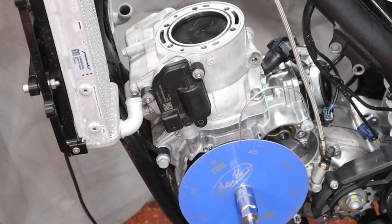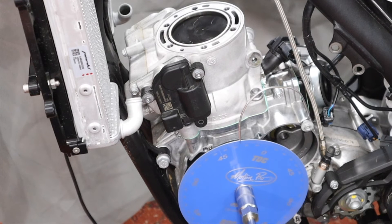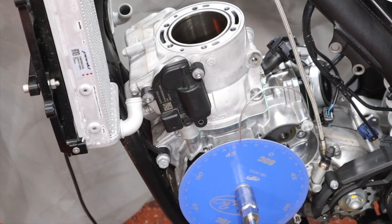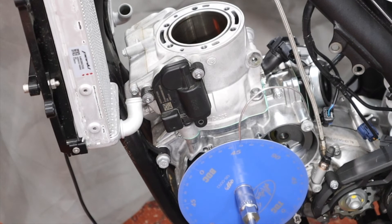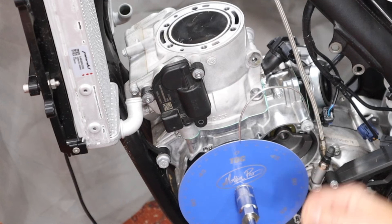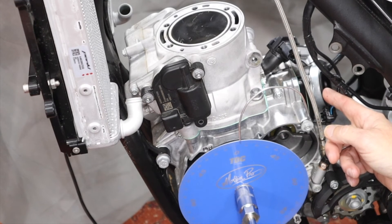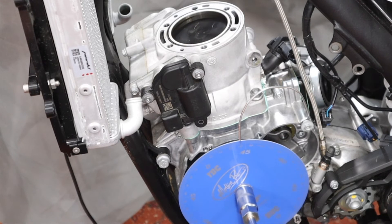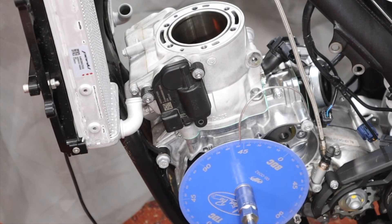For it to completely burn, at a higher RPM your timing numbers would be higher — maybe 30 degrees before top dead center at 10,000 RPMs, instead of just idling around where maybe it's only six degrees before top dead center. The other aspect of this is the filling of the cylinder. There's a suction cycle and a compression cycle on a motorcycle, and all the air has to get into the cylinder somehow to mix with the fuel, compress, and burn. We'll have our time to ignition, our air-fuel ratio, and our compression to heat things up.